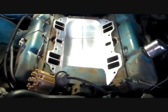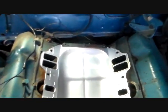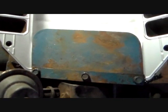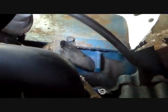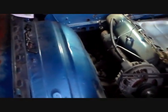I have dropped this valley pan into place and bolted it down with the retainers I told you about. This is what it looks like after it's in — strip up here, big plate on the front, strip back there by itself. There might have been a plate originally back there; I don't know, I didn't see one so I don't have one. When you get all this tightened down — and you don't have to torque the crap out of these bolts, they're only 7/16-inch bolts — just wrist tight. You should see a good even bead of RTV coming out from under that tray. I can't see back under there without a mirror, so I'm crossing my fingers it doesn't leak. I've never had one of those leak yet.